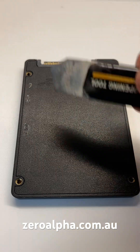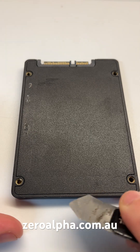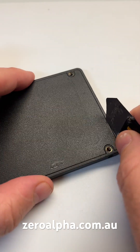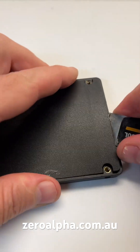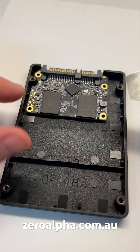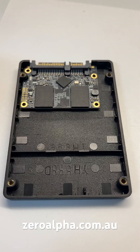To open this up, you'll need a flat tool, and it's recommended that you pry inside this gap here, away from the electronics. Just simply get your flat tool, pry inside, and lift. The reason why I don't want you to pry close to the electronics is you might pry inside and damage something, so it's safer up the back.